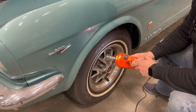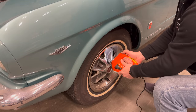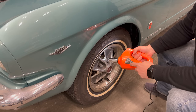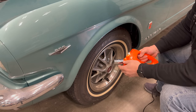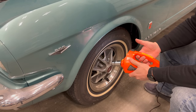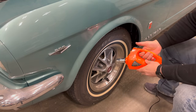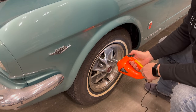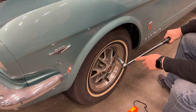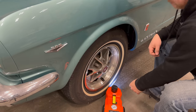The first thing I want to test is the electric wrench, so I'm going to make sure one of these lug nuts is torqued to 100 foot-pounds and we'll see if the wrench is powerful enough to remove it. We connect our power cord to the wrench — and it actually has plenty of power. It kind of spun up before it applied power, so it had a really nice hit on that socket. I'm actually pretty impressed how strong that was. It must have some sort of flywheel in there, because it didn't put much pressure on my hand or try to torque out of my hand like I expected.